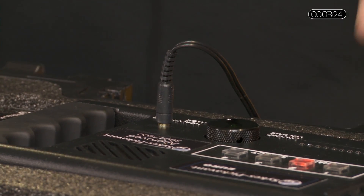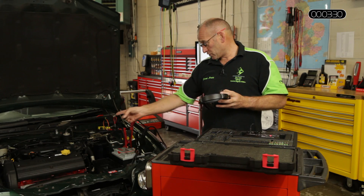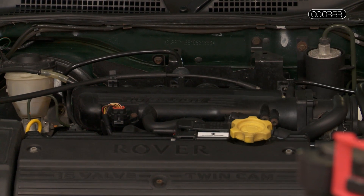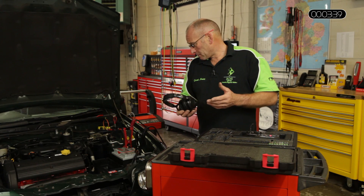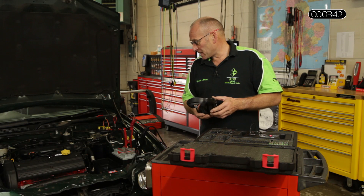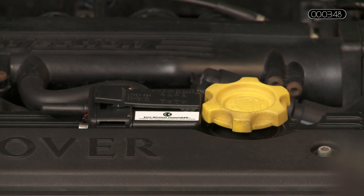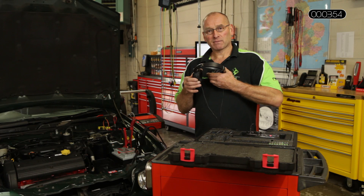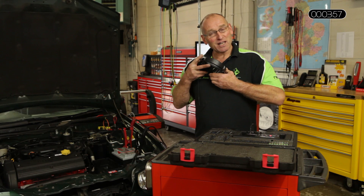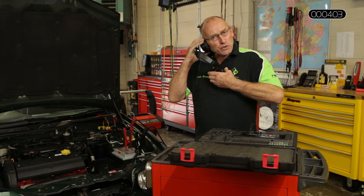Right, it was as quick as that. First of all I'm listening now to channel two. Channel two is on top of the camshaft housing and I've even left the engine cover in place. Obviously the location is determined by accessibility and opportunity, but the devices are quite sensitive. I'm listening now to mechanical functionality within the camshaft housing, and you can see that has a unique frequency and a very discernible audible sound.